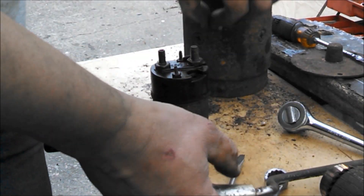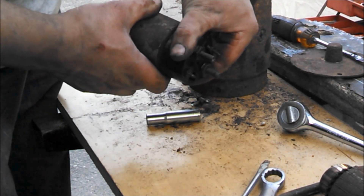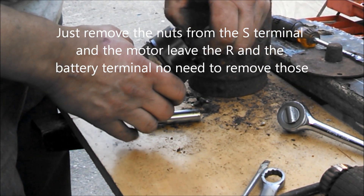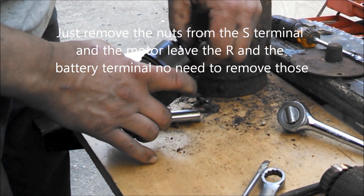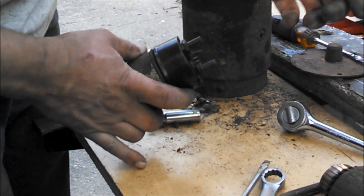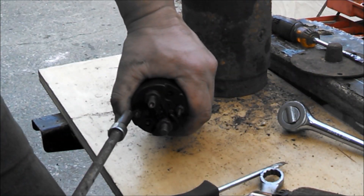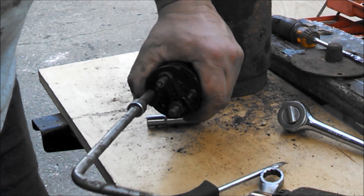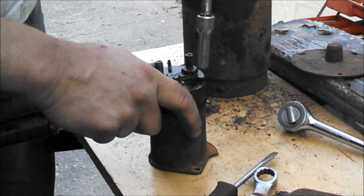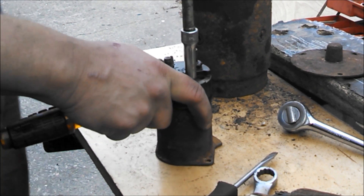These are a bit of a pain because you can't just pull this off — it's wired on the inside. You've got to get these nuts off and pull this off the studs. And when you go to loosen it, since there's so much rust on it, the studs want to spin, so it's kind of tricky to get these off. Worst comes to worst, you could just buy another solenoid for it without replacing the whole starter. But I'm trying to save a buck on this one.